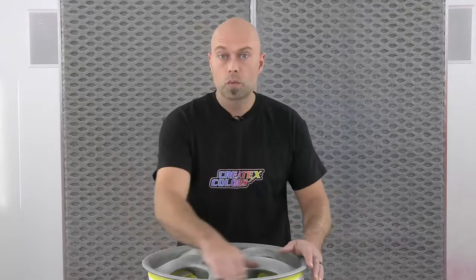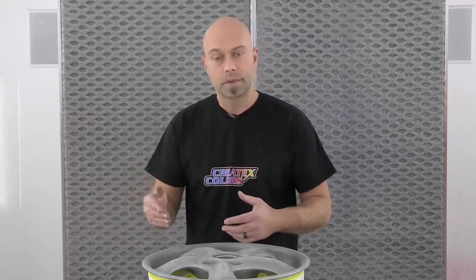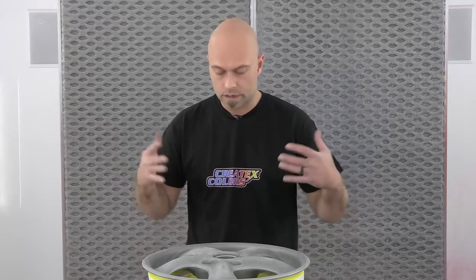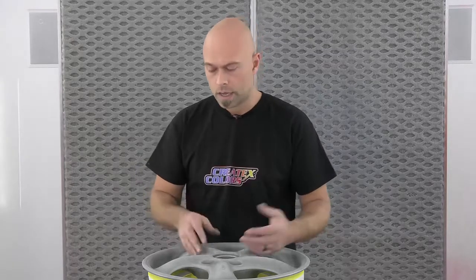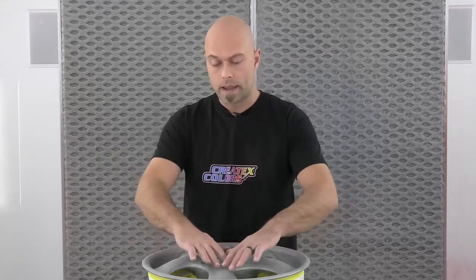So these were all wiped out. I'm going to get right into it and talk to you about what I did to prep. I used a red scotch brite pad and what is called a scuff paste or a prep paste. The particular product I used is from Presta — it's called Scuff Stuff. It's an abrasive paste and you just dip your scotch brite pad in water and a little bit of the paste and it helps really break down any kind of surface contamination stuck to the surface, especially with these wheels being on a car getting bombarded with road grime and grit and dirt. It's a nice way to break down contamination before you start sanding, because if you start sanding without cleaning that stuff off, you're actually grinding in all that contamination into the painted finish. It's water based so it's a simple rinse and it's going to help clean all that off.